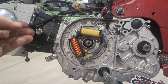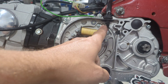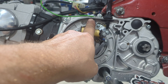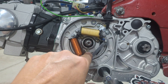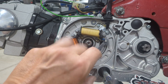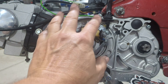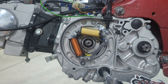To circle back to this video's example: I was firing advanced when I looked at the timing light, so I'm trying to move back towards the center line on the case at 12 o'clock. I manipulated the screws using the next set of holes because I needed to turn it a decent amount to bring it back that many degrees. I turned it counterclockwise, so I'm hoping to end up back at the center mark on the case.